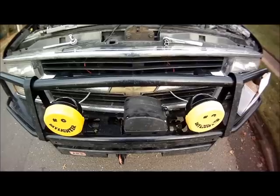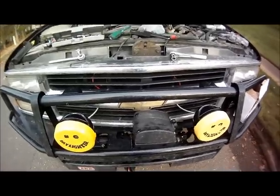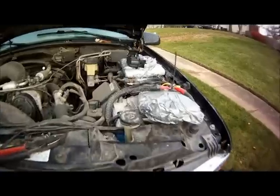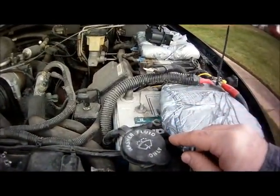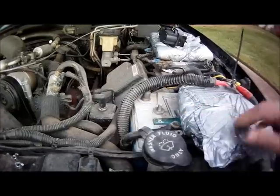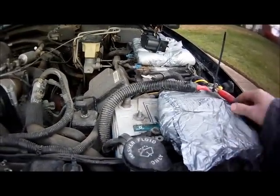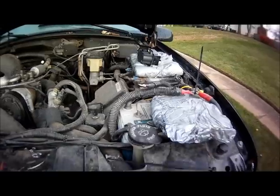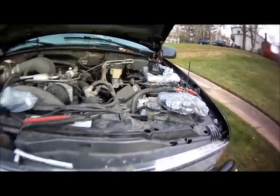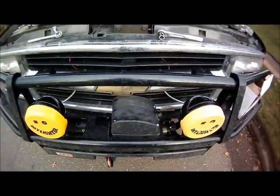So what we're going to do is start out first with the safety aspect of replacing a solenoid pack. I already started some of the prep work. As you can see, this is our second battery, which is what the winch actually runs off of. Remove the grounds from the battery. Here's all the hot legs, insulated with this piece of foam, and then zip tied. There's no way that's going to touch the battery. So when you are replacing the solenoid pack, you must have all of the power disconnected.